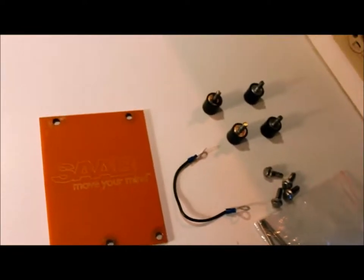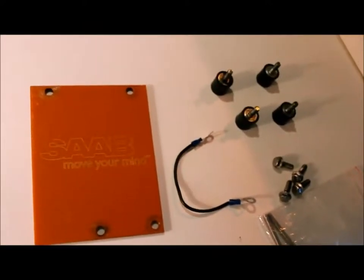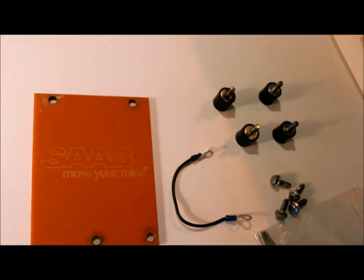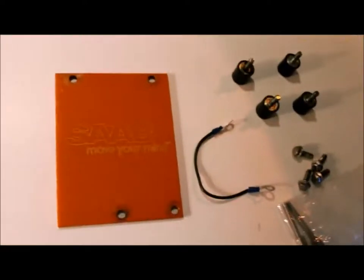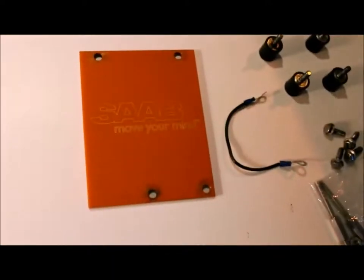This is also how I narrowed the problem down — I was reading forums and found a post about a guy whose car had been in a front-end collision. For some reason the ECU area was prone to moisture, and when he took it out the whole thing was corroded, including the ground wire. Different situation, same problem — it's that ECU ground wire. If you've ever messed with the ECU or taken it out, you'll know exactly what I'm talking about. There is a ground wire that goes right into that corner and grounds the ECU.